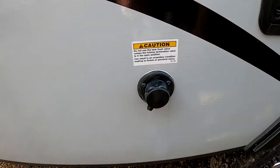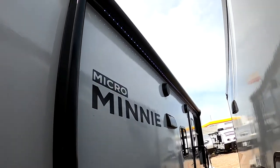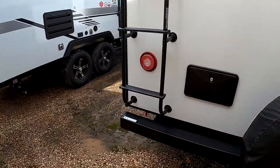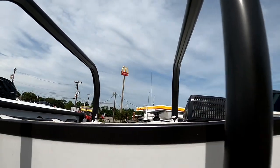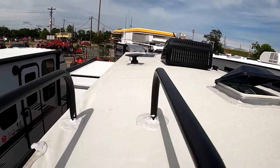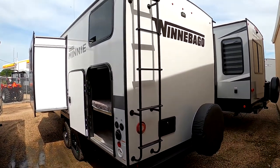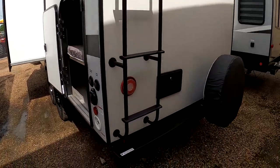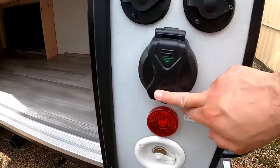Power connection, coaxial connection, black tank flush — whenever you dump your black tank, make sure the valve's open, hook up a water hose, and it cleans out the tanks for you with built-in nozzles. Big electric awning with white LED lights. Here we have the controls for the rear stabilizers. LED taillights — much brighter and safer than incandescent bulbs, they'll practically last a lifetime. This is ready for a Voyager camera — nice thing about the Voyager is that you get video and audio. Up top we can see the solar panel — it's 100 watts and comes built in from the factory. This is a TPO roof, a big upgrade versus rubber: more UV resistant, and if you walk on your roof you're less likely to slip because it's a coarse felt and vinyl material. It does not chalk and make your RV dirty. You also have an outside shower here with hot and cold water. Spare tire and a bumper so you can put your sewer hose in there. Cable and satellite prep. 30 amp power and city water connections.